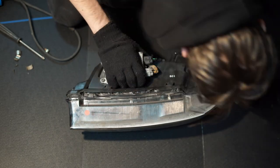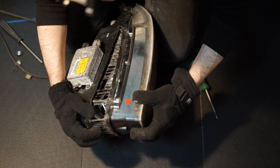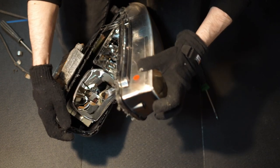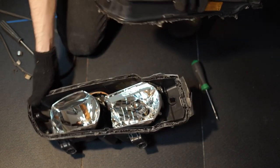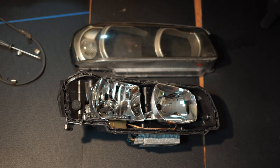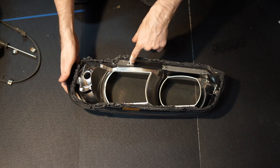If you see that your screwdriver starts bending a little, this is already too much. Put the screwdriver away for a few minutes and heat the slot again. Push the glass out little by little with your screwdriver in different places all around the glass perimeter, and you will see that it slowly comes out from its holding slot. Once the headlight is opened, remove the holding screws on the inner bezel and push it out from the glass.